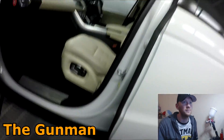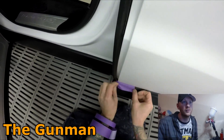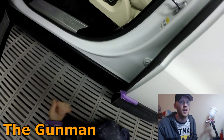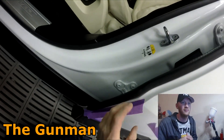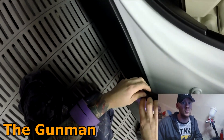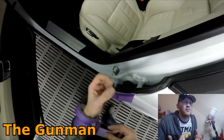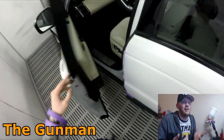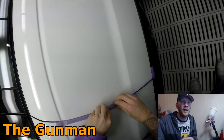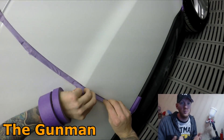I like to have a rag in my pocket when I'm doing the masking, just in case there's a little bit of dirt on the edge. I find it's not usually necessary to wipe a job down with wax and grease remover before masking, unless there's silicone or a specific contaminant on the panel, because you're going to wipe it down with wax and grease remover before you paint it anyway. I've done it both ways and haven't found it comes out any cleaner.